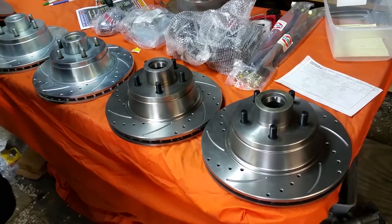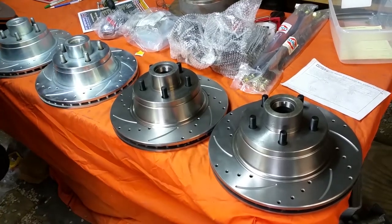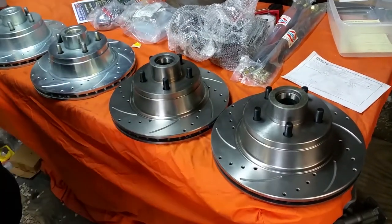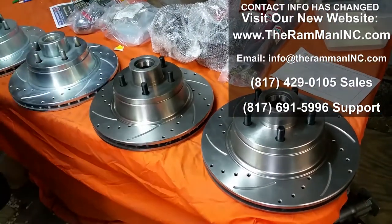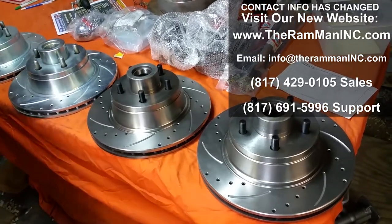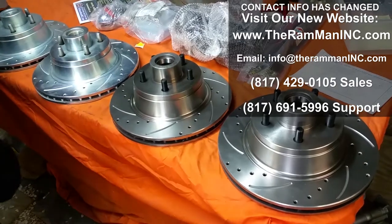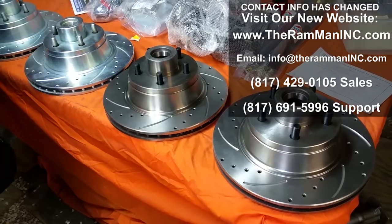So if you've got a problem with one side of the car, you've got to check out those components. The first way to eliminate a problem is to get it checked and take that out of the variable mix. The only way to check a rotor is to dismount it and get it checked for thickness variation and whether it's running true. Once you have that information, you can put that to bed and get on to the real problem that's causing the noise or clunking. Thank you.